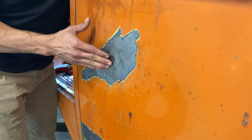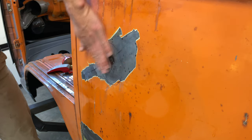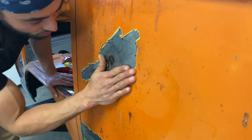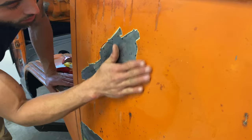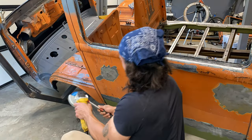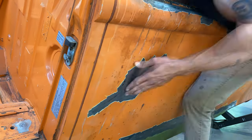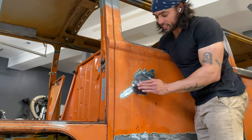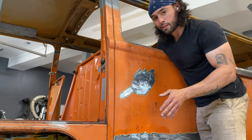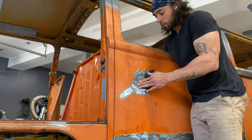So we have gotten rid of the oil canning, and it is just about as solid as any other part on this door, but it is a little dinged up — it's pretty flat. I could just bondo over that. It's a lot flatter than it was, but I'm going to attempt to hone my craft and try to hammer it smoother. So we're going to clean up the surface, clean up the backside, and take our time with it. It is no longer oil canning — it's not perfectly smooth, but it doesn't have any huge dips or bumps, so I should be able to just put some filler. I don't really want to stretch the metal again and risk oil canning it, so I'm happy with that.